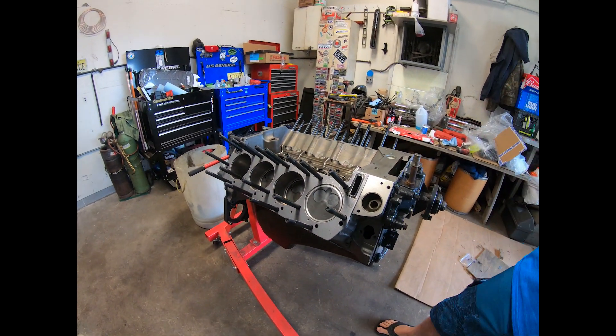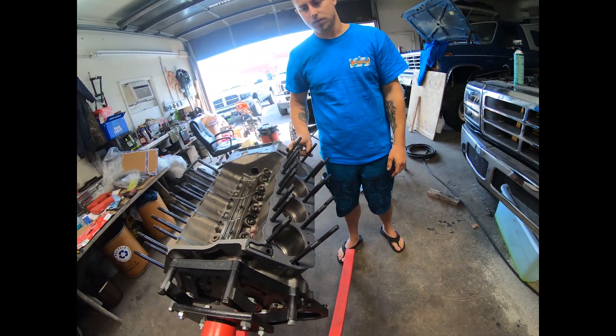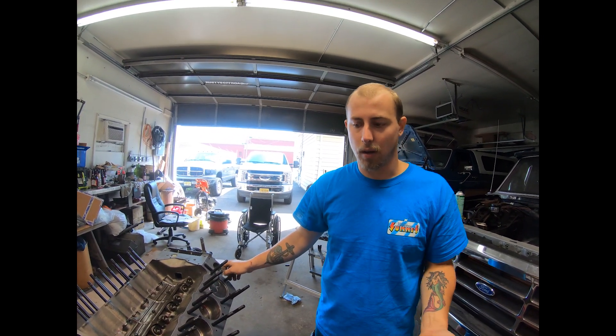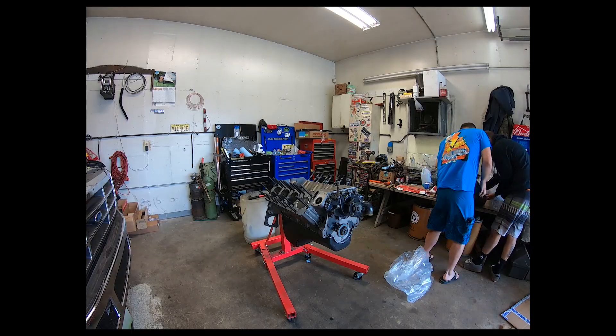Today we'll be studded and gutted. So instead of using regular bolts, we'll be using head studs. The only head studs to get are of course ARPs — they're the only ones made for this engine. The reason I have them is because anything more than probably 10 pounds of boost and you really can't run stock bolts. People say you can go higher on IDIs, but you really can't. I want to make 15 to 20 pounds, and you need head studs, so we got head studs.